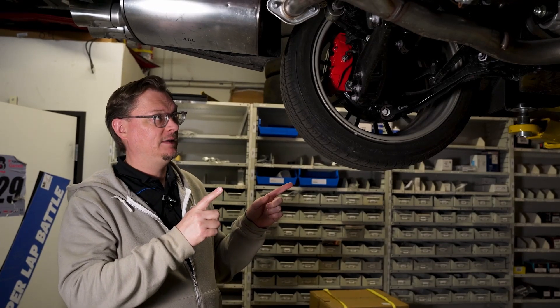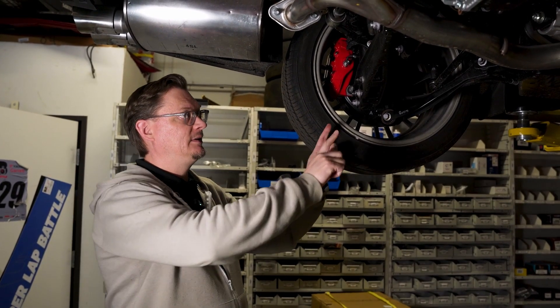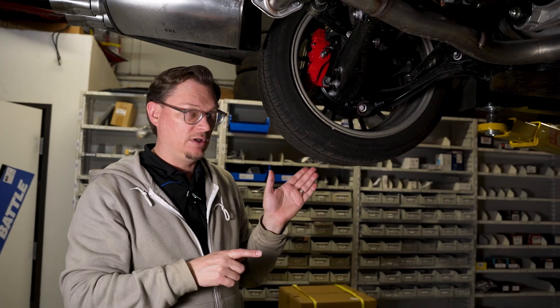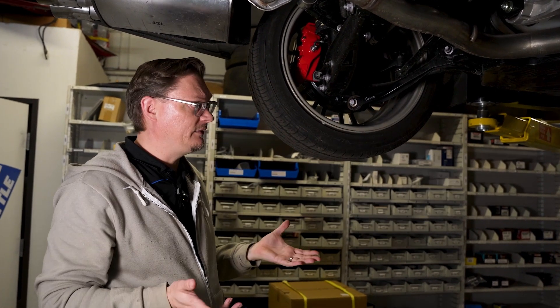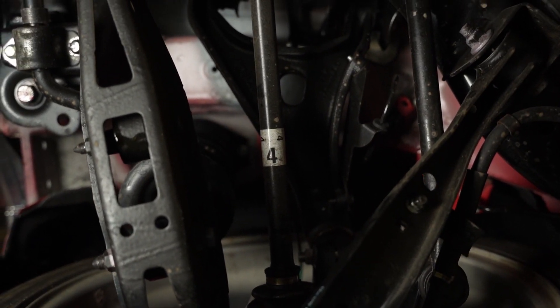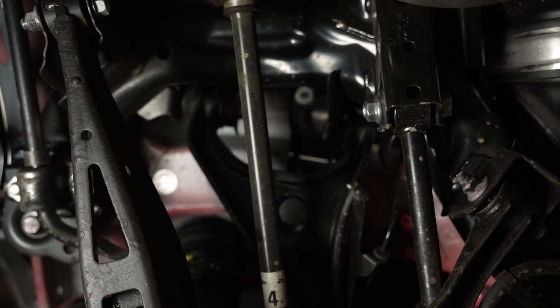We've got the VB back in the shop, up on the lift. Looking at the suspension — the lower control arm, the strut placement — all basically unchanged from the GR WRX. We know this because the part number for the lower control arm, especially for aftermarket ones, is unchanged. Same length, same mounting points, same strut mounting point, same strut length. What is different is this trailing arm. On the GD WRX, the lateral links and trailing arm are basically perpendicular. With the GR WRX, still largely perpendicular but they started to move the trailing arm in a little bit. On the VA they made it a lot shorter and more inboard. But this VB trailing arm is different again — we believe they've moved the forward mounting point even further inboard. We know it's different because there's no cross-application for this trailing arm, and it just looks a lot longer than before.